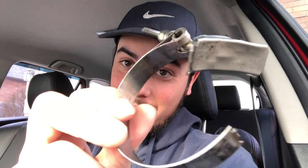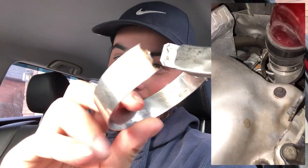Alright guys, it's currently the next day, just finished work. So about that test drive — epic fail. I took it out on the highway, made sure it was clear, went for a pull in third gear, romped on it, and kaboom — I'm like what the hell happened, must have blown a clamp or coupler. The result: I literally snapped the clamp around the turbo connection — tightened it too hard. Luckily I had an extra clamp from my stock top mount intercooler. My buddy showed me I hadn't tightened it at the right location. It happens with intercooler piping — unless you're really experienced, stuff's gonna blow off.